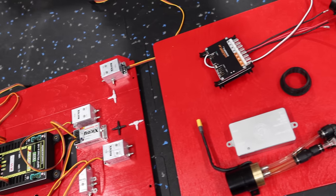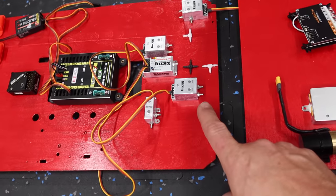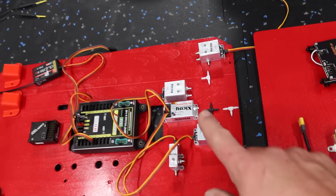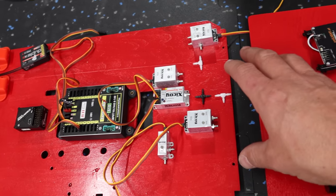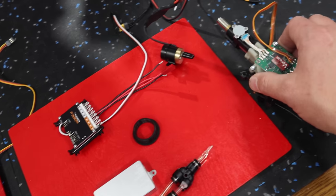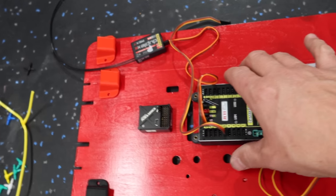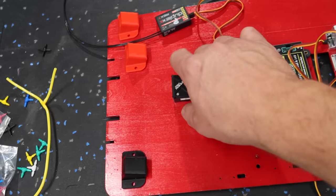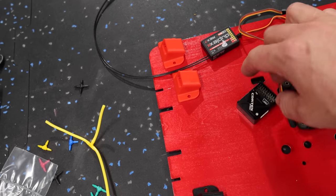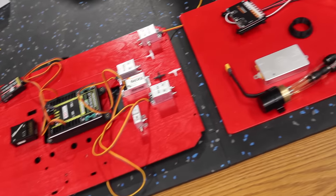Working on tray layout, and as per usual, a lot of thought goes into this. The reason the air stuff goes right here is this tray is lifted higher than the front tray, so there's a nice path underneath to run airlines. The air compressor is going to be underneath the tray to keep things clean. The front tray is pretty simple — just the Cortex and central box. Standard Cortex placement has output plugs facing forward, but we could flip it around too.